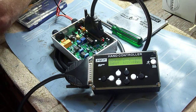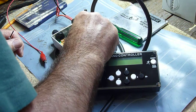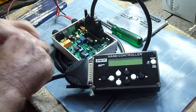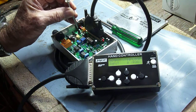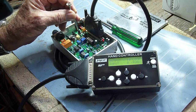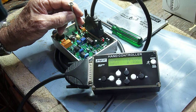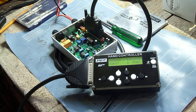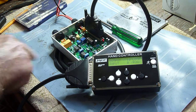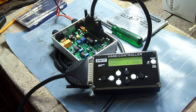So now I'm going to disconnect the power, put the lock pin back over, connect the power again, and you'll see that red LED came on. To get it ready and back in the car, I'm going to screw that VR4 back down one turn. You'll notice that the LED stays on — the reason for that is the relay has switched. So if I take that off and put it back on again, you'll see it doesn't light up.